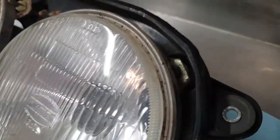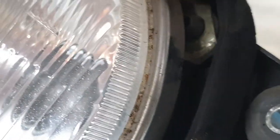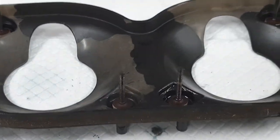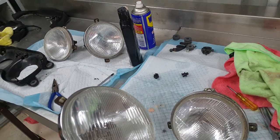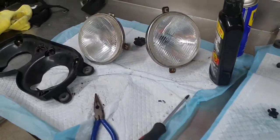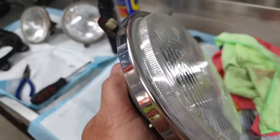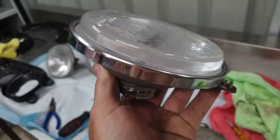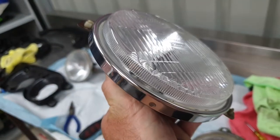Here's the housing that I'm going to use - it's all stripped down. I'll clean that up and rip this other one apart to steal the parts I need, like this little mounting point in here. Then I'll have a look at what all the parts look like clean and put it back together. I've picked the best two beams to put back into the headlight housing. They started out looking a bit rough, but with a little bit of polish they came up really nicely. I'll clean the other one up and assemble it into the housing.